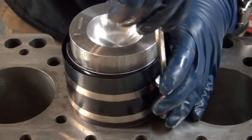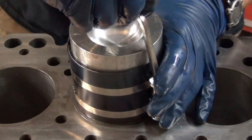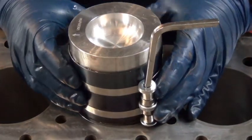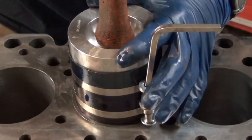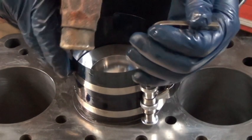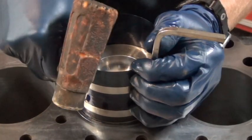Put the compressor around the rings. On this one you've got to line it all the way at the bottom. Good piston ring compressor practice — like paper airplane practice — you've really got to line up your edges because it spans the whole thing. Get it to where it's nice and snug, then go a little more. You can use the back handle of a rubber hammer. If you find that you're hanging up, try tightening it a little bit more.